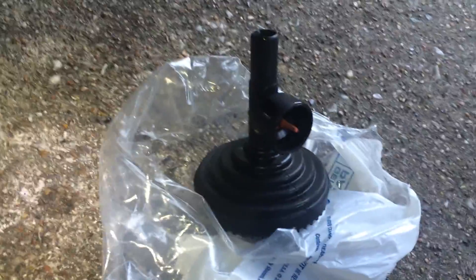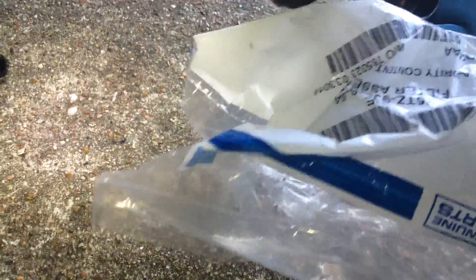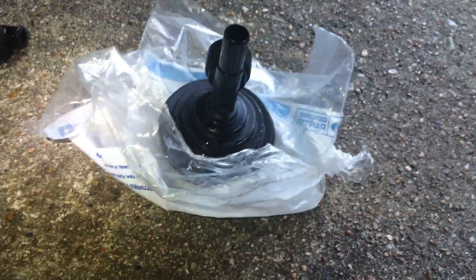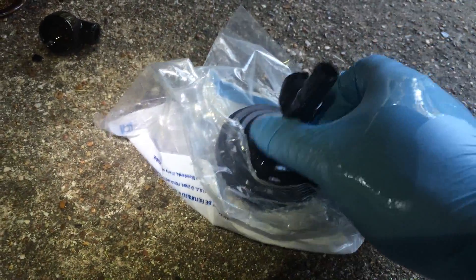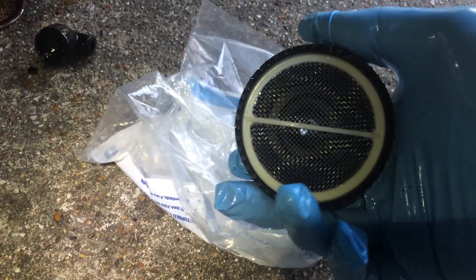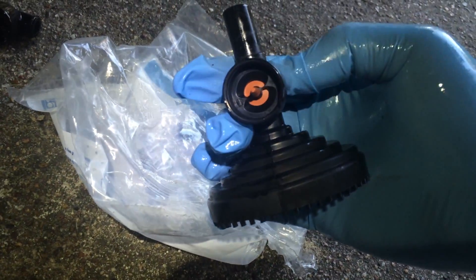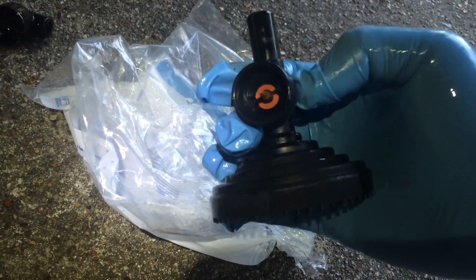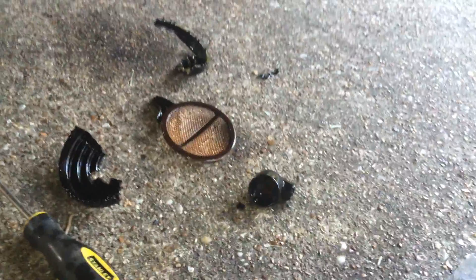Here's the new part that's going on. This is actually a Ford OEM replacement part — I got it from Riff Raff Diesel for about 40 bucks. This sits flat on the bottom of your tank and is your main uptake. It also has a little bypass valve mounted on the side, which I guess is supposed to let it not take fuel off the absolute bottom of the tank until it has to. Once fuel gets down past that level the bypass closes and it starts picking up from the bottom.